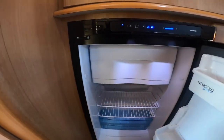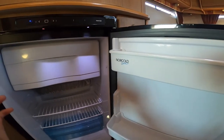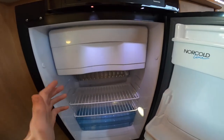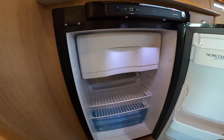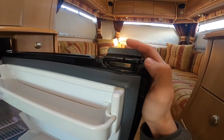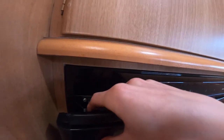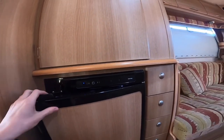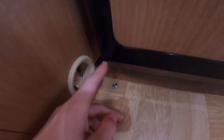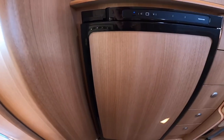When you're not using the motorhome, clean the fridge out, take all items out, give it a clean, and then don't shut the door — it's got a rubber seal so all the clean air will be trapped and it'll become mouldy and bacteria will start growing. Instead, lift the handle release and underneath is a black little clip. Put the black clip into the clip on the frame of the fridge and it'll leave the door open so air can ventilate in and out. When in use, you've got a travel catch on the bottom to lock the door so it won't open when travelling — but remember to take the catch off before you open the door.